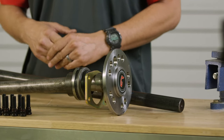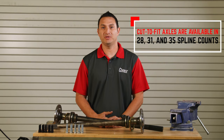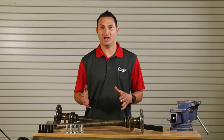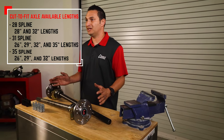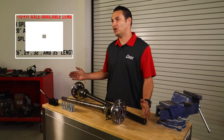This gives you some flexibility when you're making those cuts and building something custom at home or at a shop. Our cut-to-fit axles are available in 28, 31, and 35 spline counts, basically available to make up to whatever nine-inch third member you may be running in your vehicle. We do make these in a few different sizes — available in 26, 29, 32, and 35 inches long.